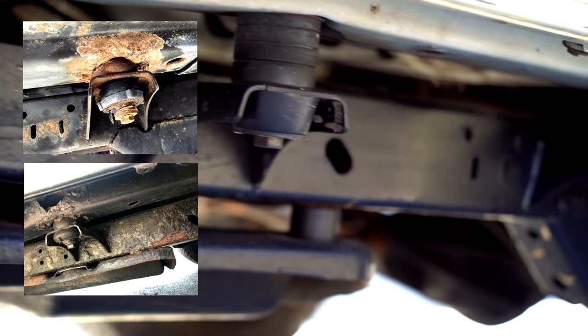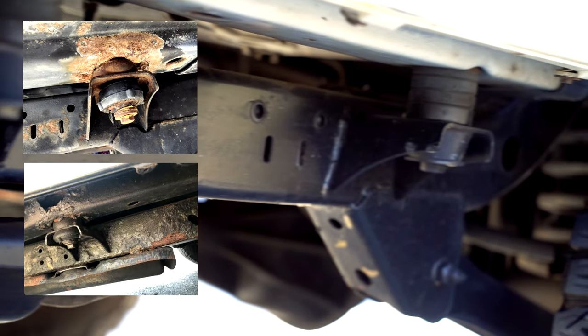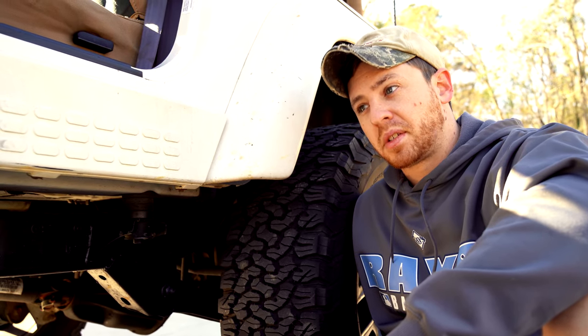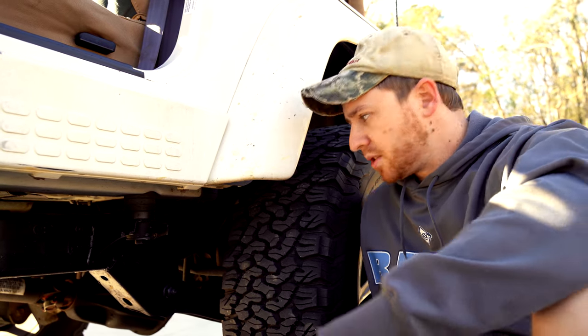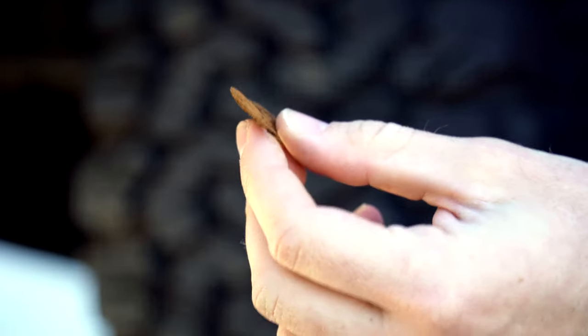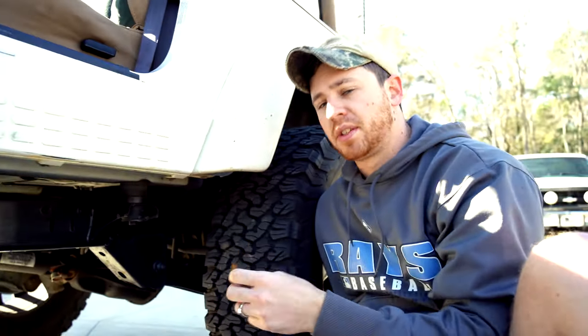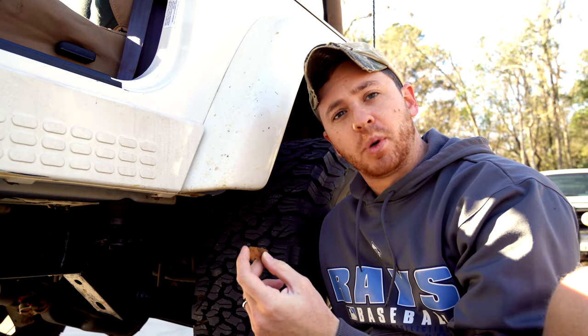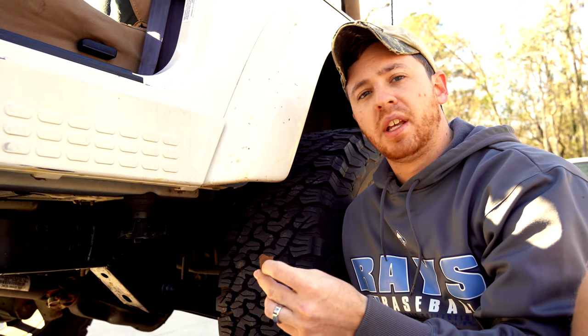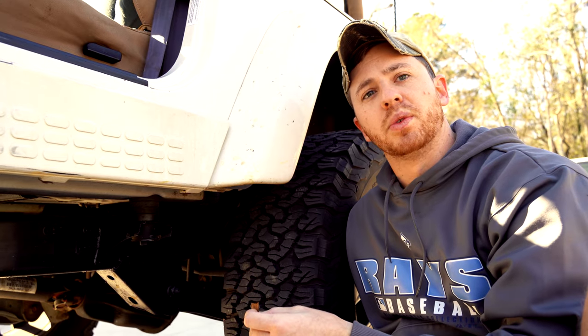While you're down here looking at the frame, take a quick look at the body mounts. You can poke your knife up here as well. Make sure these aren't rusted out because this is what actually keeps your cab attached to your frame. There's another hole right here in front of the rear tires - put your finger in there. There is some chunks of rust in here. It's pretty much impossible to find a Jeep that doesn't have some scaling on the inside of the frame - even this Southern car has that issue. Unfortunately the frames weren't engineered well to drain water out. A lot of people like to drill holes to create ejection ports for the water once you buy your Jeep.